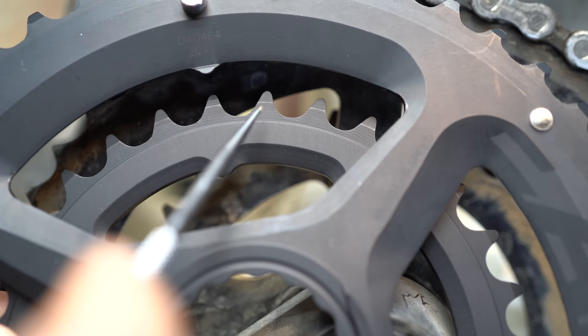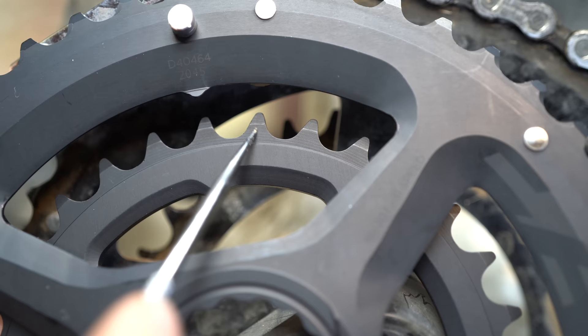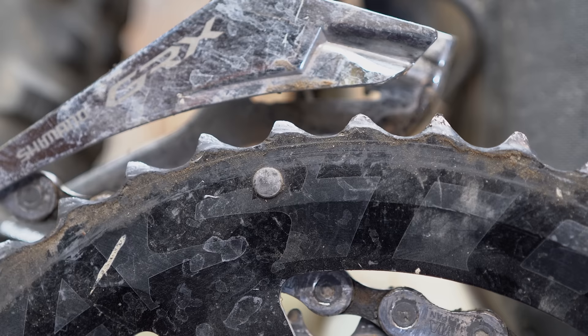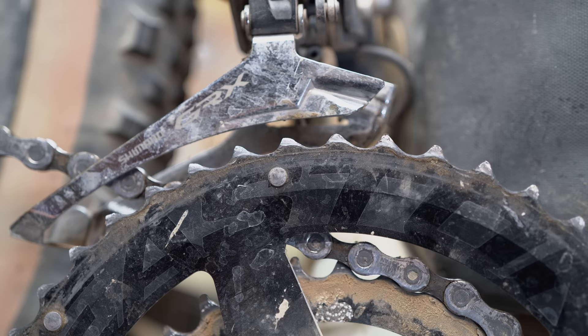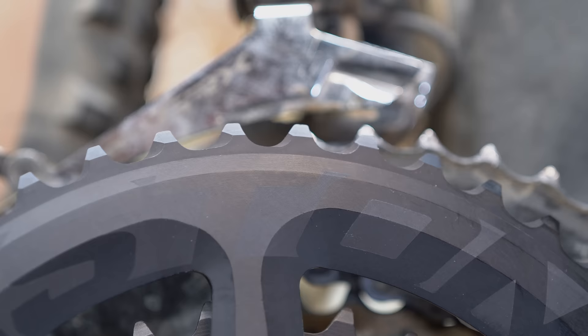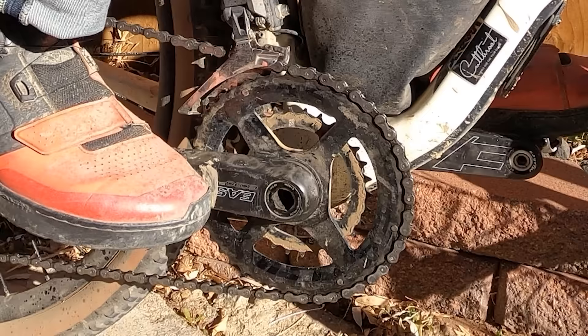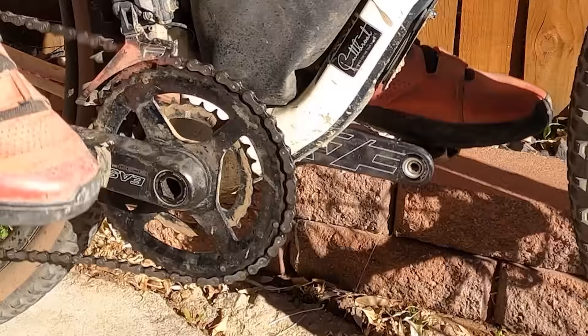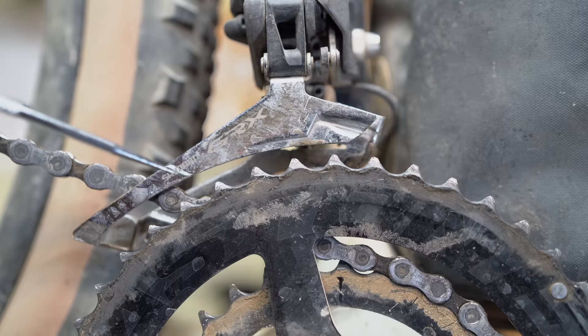You can see the uniformity in these teeth and there's just more surface area on the top of each tooth on the new chain ring. Shifting the chain down to look at the large chain ring — it is just a complete mess. Because this chain ring got so worn over time, when I shift up it has a very challenging time, which leads to more wear and tear on this big ring. Most of these teeth are super sharp. Last week when I added chain lube, the chain actually ended up skipping over many of these front chain ring teeth, especially under moderate effort. That's when I knew the drivetrain and especially the front chain rings were toasted.